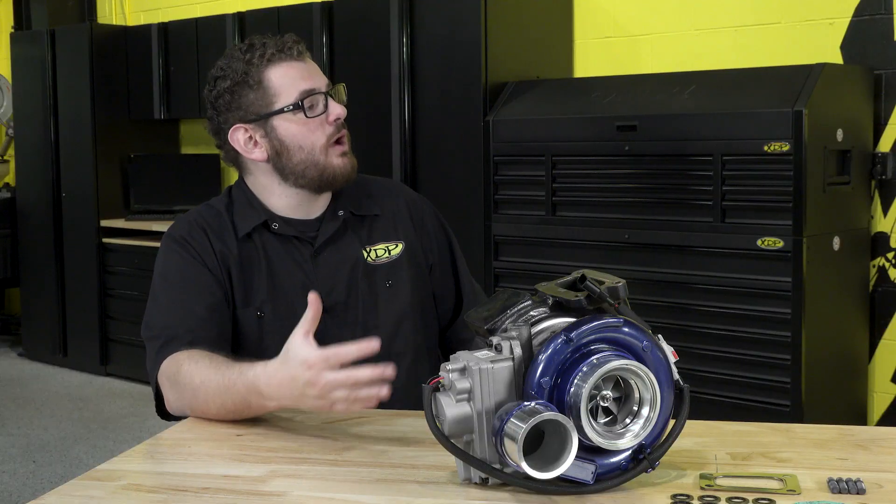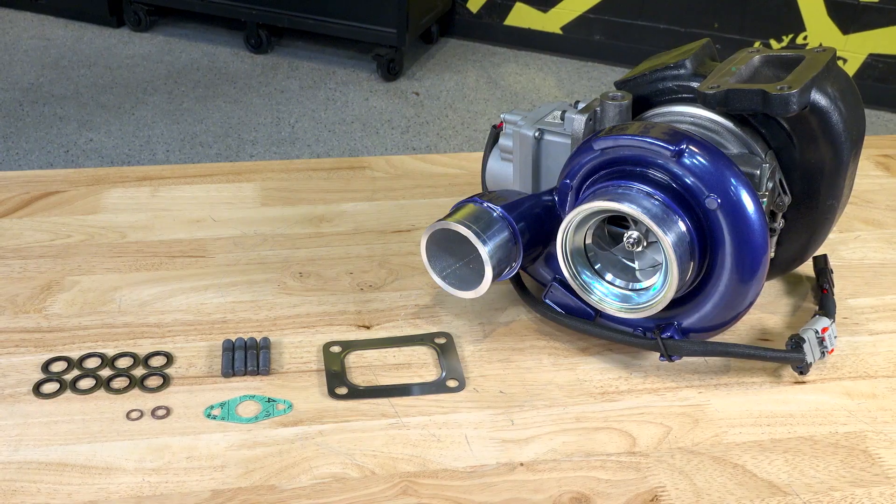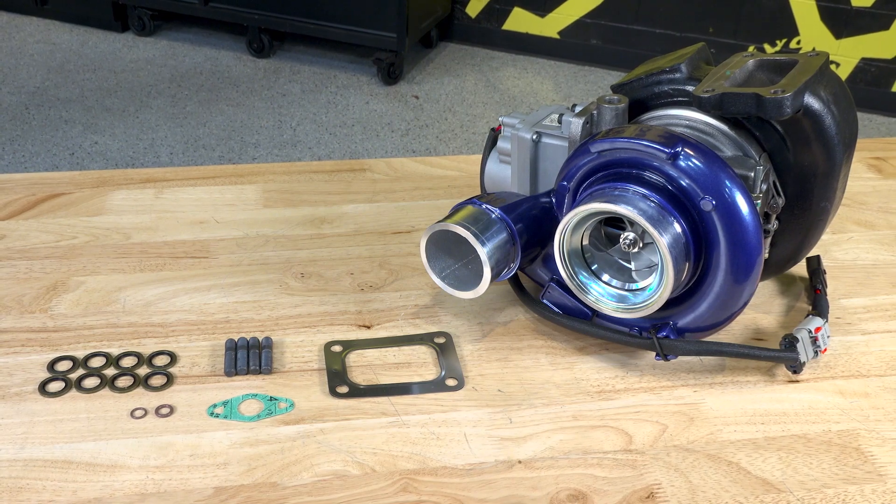What else do we need in the truck to run this turbo? Is there any tuning required? The nice thing about the VFR line is we've designed a couple different stages for you. The 3000 line is going to be your stock size inducer, so you're going to be able to put that on a stock truck with no tuning — it's just more reliable, better EGT handling, and a little bit more power. You'll probably pick up about 30 to 40 horsepower just because of the sizing we've done with no tuning at all. However, the 4000 series for guys that do have some tuning done to their truck can handle up to almost 650 horsepower.